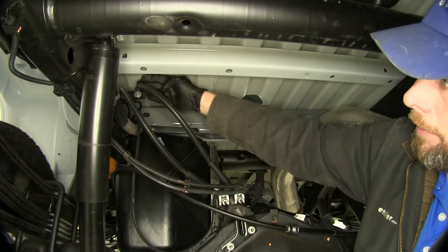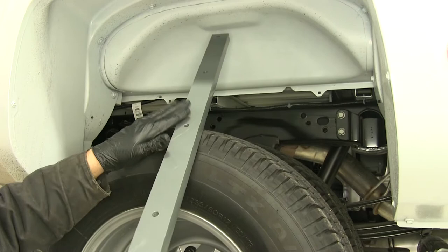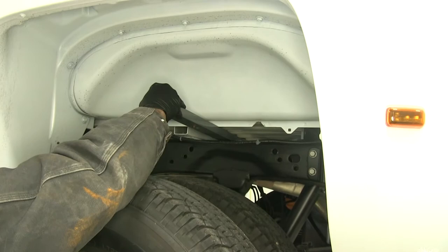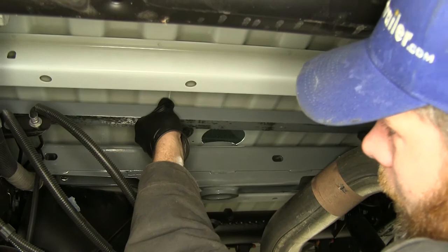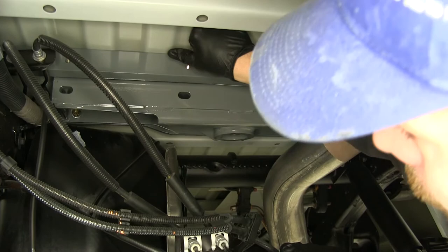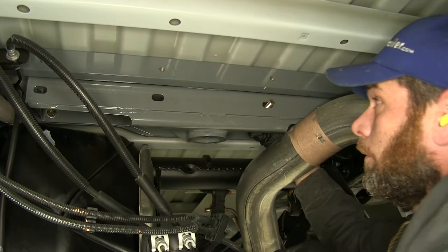Now let's get our rear crossmember put across here. You'll notice these holes are just a little bit closer to one side than the other — when it's in position, we want those to be closer to the bottom, so just keep that in mind. Slide that right up and over just like we did our other one, go underneath and help it on across, then rotate it up into position. We're going to align the threaded holes in our rear crossmember with the slots here, using our longer two-inch half-inch bolts with a flat washer and a lock washer, putting those through and threading them right into the holes. Then we can go through and get the rest of our hardware started.